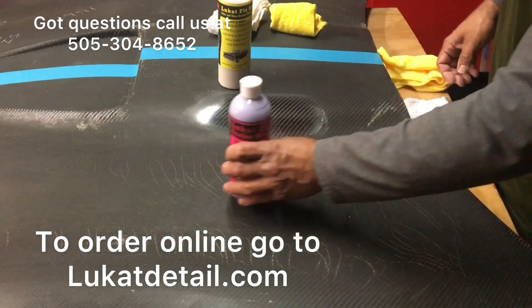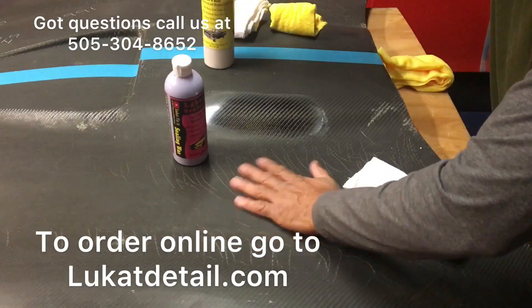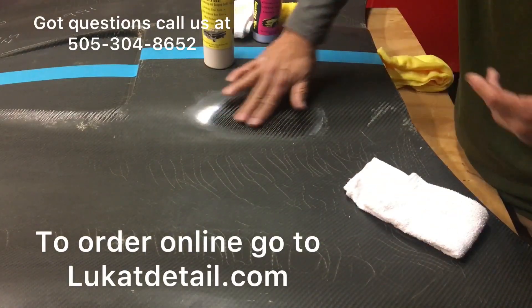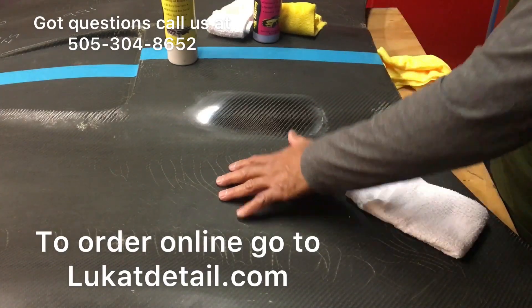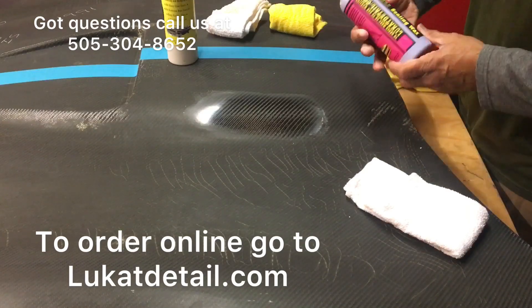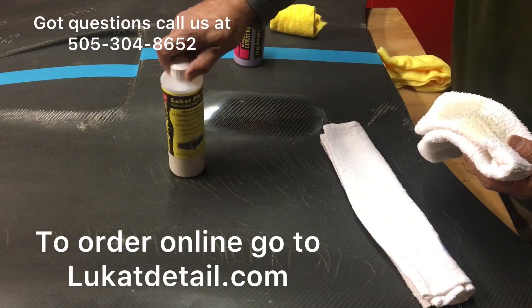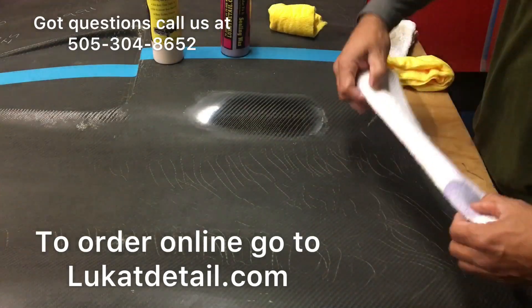Now, when it comes to the sealer wax, it's a lot, lot easier. The cleaner — remember you're working on this. Listen, that sounds terrible — hear that? That's because it's contaminated, it's oxidized, all that. Now here, you don't hear nothing because it's smooth and shiny. That's what this is supposed to do. It brings it back, because you can't wax a paint job like this. If you wax this, it actually gets worse because you're masking a problem, and then the wax becomes part of the problem as well. Always use separate towels. Do not use the cleaner towel for the sealer, because this cleaner is designed to break down lubricants — that's what it's supposed to do, and it's one of the reasons why it works so well.